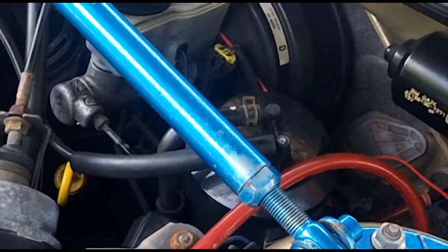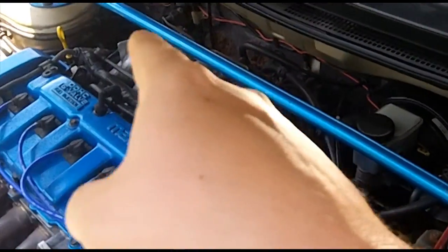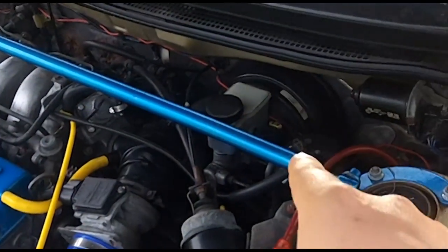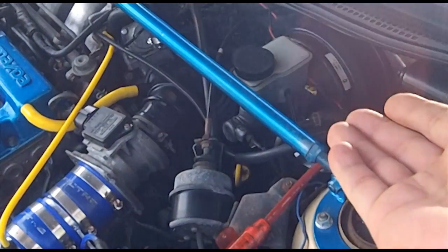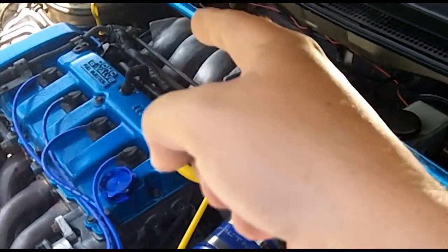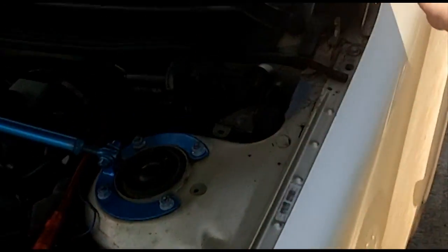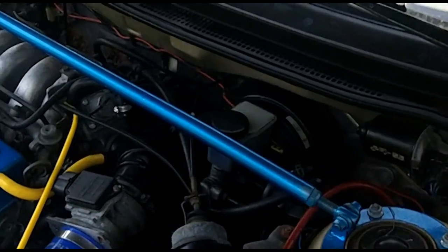Now, how long does it take until you need to replace that? Well, Mazda says that it's 100,000 miles between each inspection of your entire Purge system, your vapor vent system. And that includes a charcoal canister. I would expect those to last 4 or 5 years. So I would say on average 4 or 5 years to replace a charcoal canister, and every 100,000 miles to inspect the integrity of the lines, and that includes going under the car all the way to the gas tank for your vapor line.